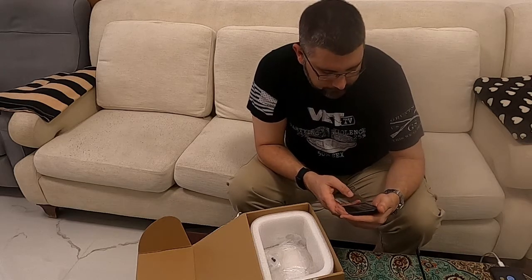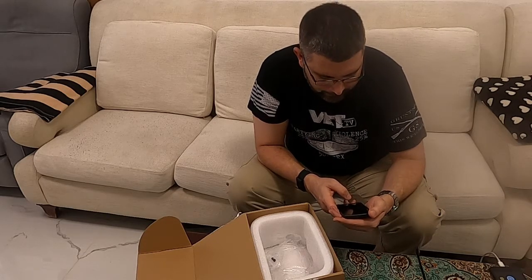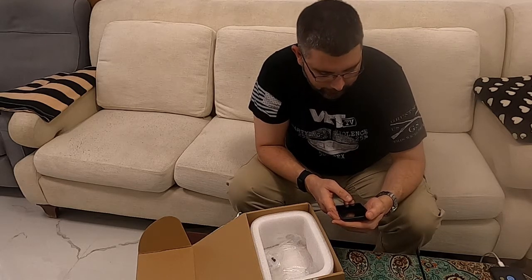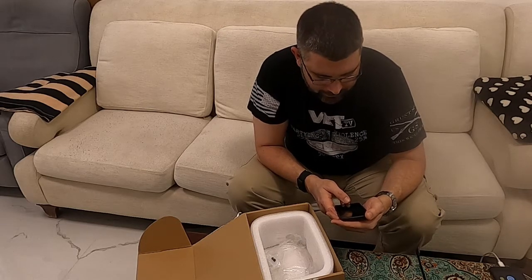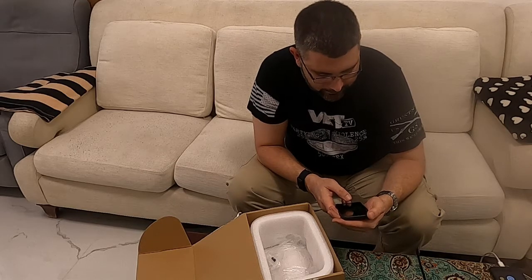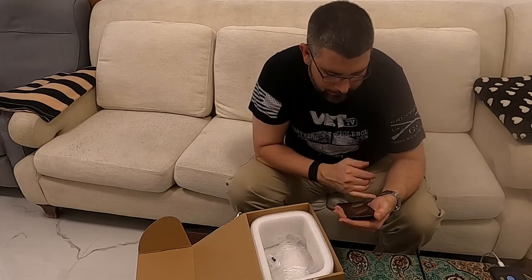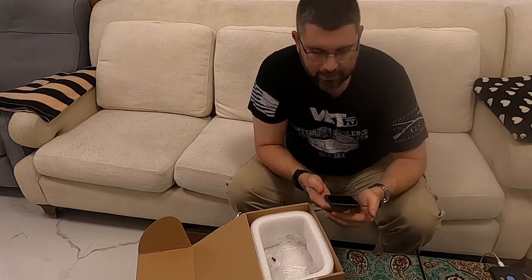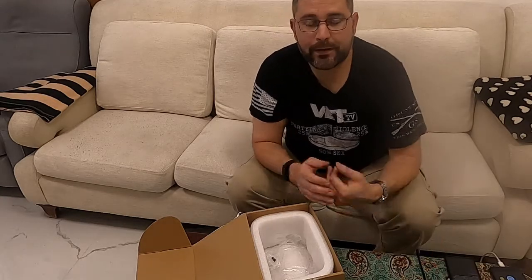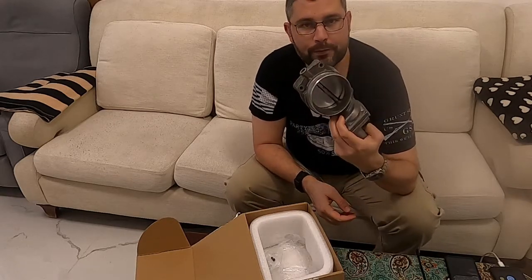He says: 'Thank you very much. I can see you get pretty deep into the technical details. It is the shaftless front side which carries most of the responsibility for making it 95 millimeters effective when the blade is fully open. The projected added flow area of that missing shaft is what makes the throat area bigger and equivalent to that of a common 95 millimeter throttle body.' So that's where you get your extra five millimeters from.